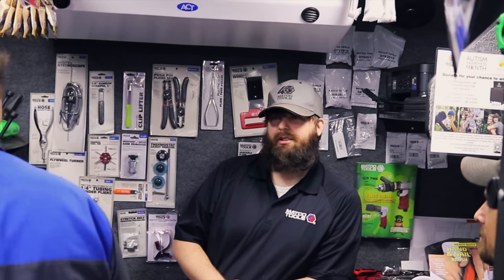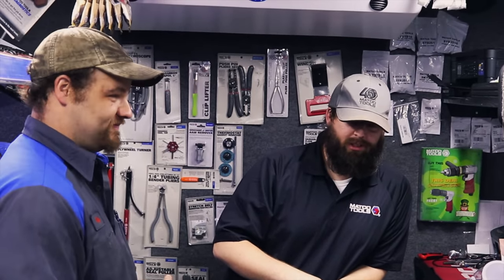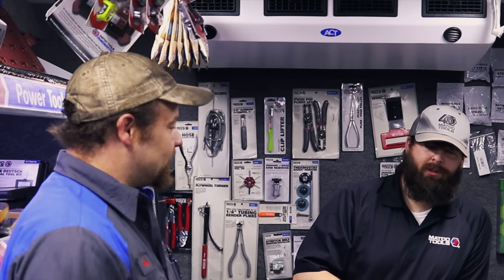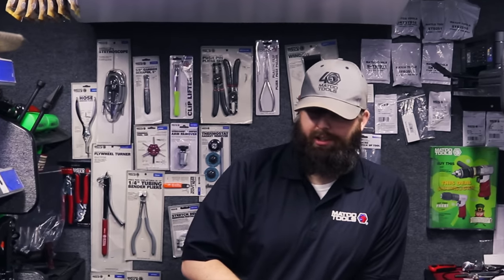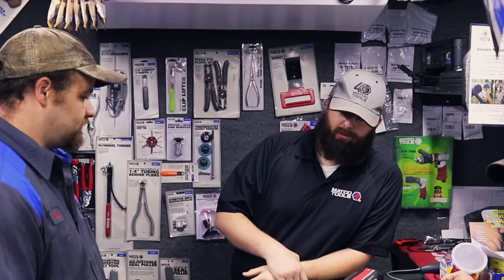I've got a monster with a pry bar. We used to fight with those things — it'd take two or three people, one with an air hammer and one with a long pry bar. If you ever run across one again, get somebody to slide under there and hold that pry bar against it and get somebody on the other side with that big 20-pound sledge — she'll come out of there. Either that or the engine's going to come through the fender. We got pretty good at it, but even then there were some we had to take the bolts out — three bolts holding that carrier to the top. And you had to take those out and wrestle the engine out around it. The only bad part about leaving the axle in and doing the engines — if you had to let the lift up and down several times, they were going to separate, and then you hadn't put the axle back together and greased it and put one of those clamps on it.